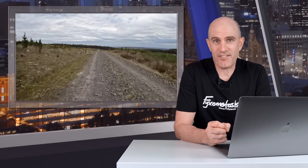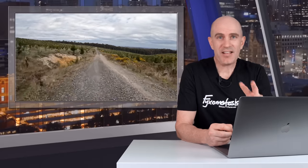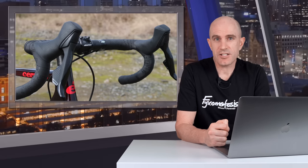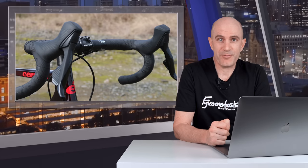My overall impression of the bike — it was fast, and that's probably due to the fast road wheels we've put on it. The 50mm deep wheels from Scribe, the 40mm tires from Goodyear, plus the brand new groupset and new chain — everything feels fast. Before bringing Von in, the two things I would personally change: first, the rear gearing — that 36 just isn't enough with the Rival. The Rival is maxed out at 36, so the options would be to go up to the Explore, which gets you a 44-tooth on the back, or go full mullet with the Eagle, getting up to a 52 on the back. Secondly, the Rival AXS levers don't have auxiliary ports for those climbing shifters — multi-clicks or blips, as SRAM call them. You could add a blip box, but that's an expensive way to add those auxiliary shifters. But overall, the Rival performed very, very well.